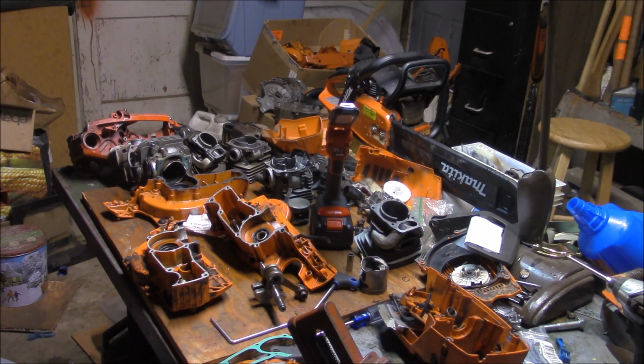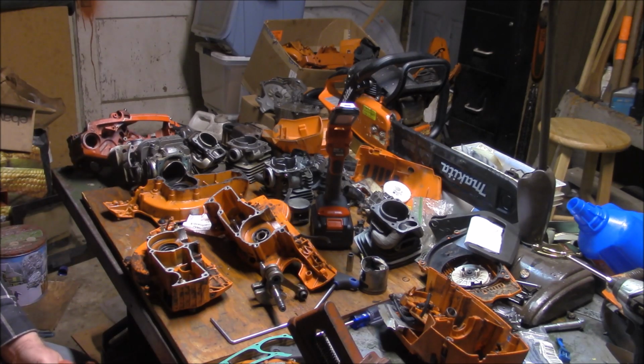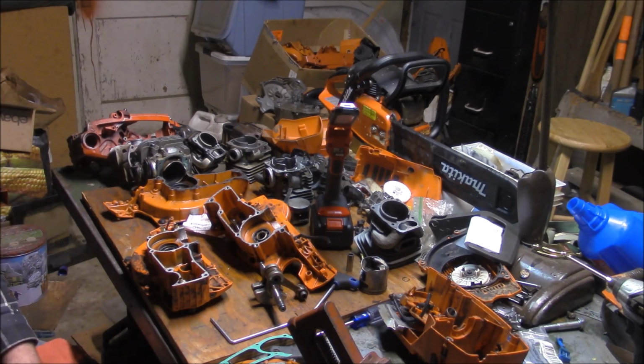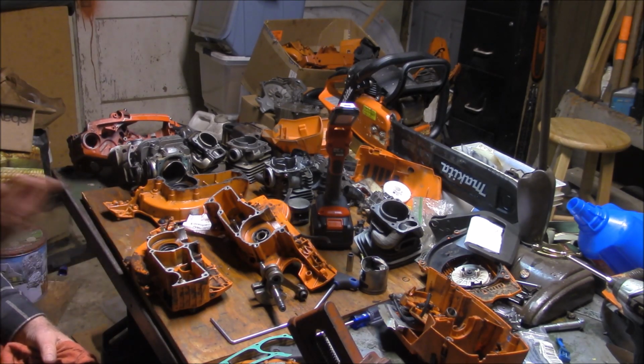Husky may have been responding to the bigger piston rattling those cases apart early on with the steel cage bearings, and maybe that was one of the reasons why they went to the nylons. And then another issue might have been introduced in manufacturing, where they were running hot and the nylon cages were getting brittle and cracking, and then they'd fail. Because when I took them out and put the steel cage bearings in, slapped them together, glued them together with 1184, those saws didn't fail.